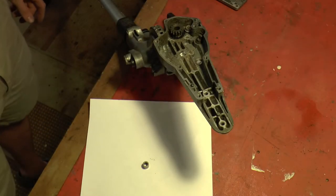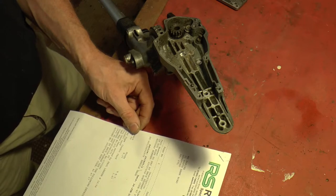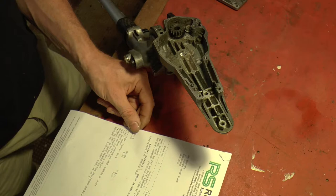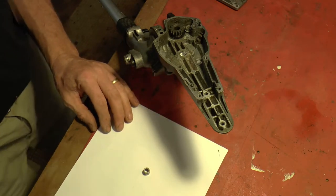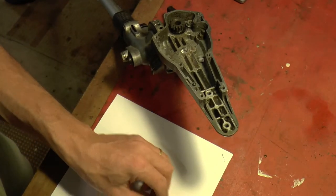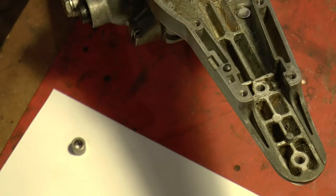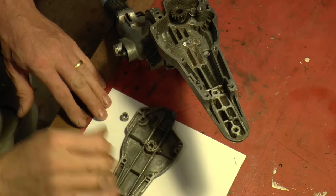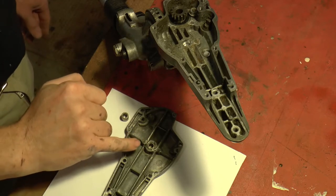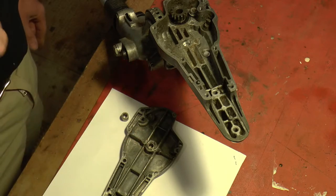The little bearings have turned up - got them from Ron Smith. They're basically needle caged bearings. The part number is ST95130031570. These are very small little bearings. I've cleaned up the hole in the main head and push fitted the bearing into the other part - it went in pretty easily. I just cleaned it up with methylated spirits, put a little bit of grease in, then tapped it in with a bit of dowel and a mallet.